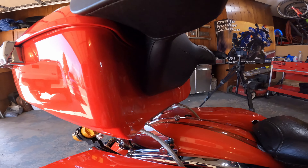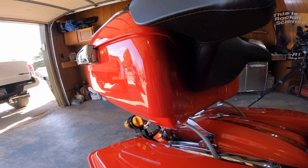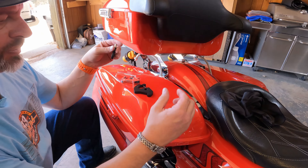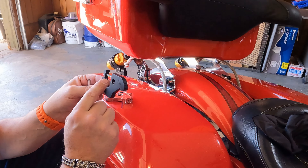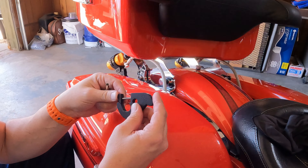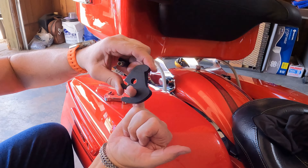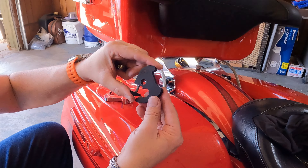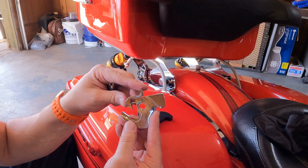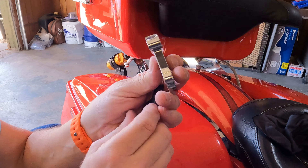These trunks are not cheap, and you can see how easy it is to release them — just release both sides and walk away with the tour pack. There's also the hassle of having to buy a new one and wait for Harley-Davidson to match your color. The lock setup is simple: a screw goes through, there's a spring-loaded bar you move out of the way, then you twist and pull it off the bar. The Harley replacement has the same spring-loaded mechanism with a small lock and you get two locks and two keys.